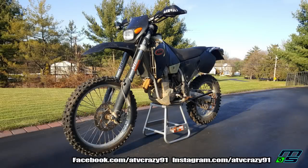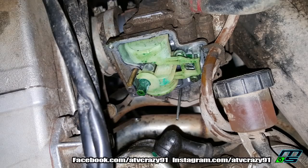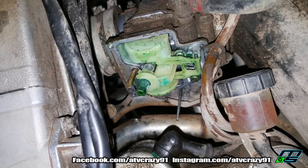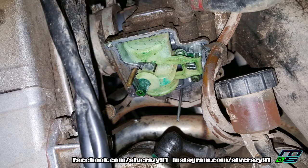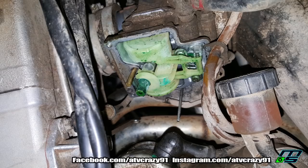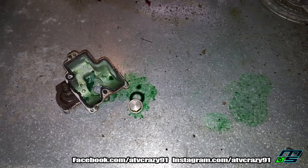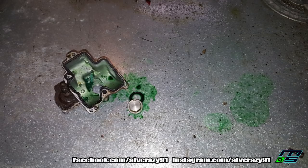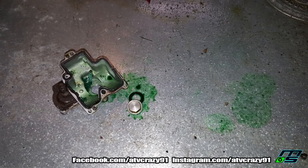If you enjoyed this video please give me a thumbs up, comment, and subscribe. Also, I did get that 400 EXC finally running — I cleaned the carb and when I pulled the bowl off there was this thick green goo. Never seen gas look like that in a four-stroke. Cleaned the jets out and now it starts up and runs pretty good. I just wanted to get it running since I have it up for sale and a running bike is worth so much more.